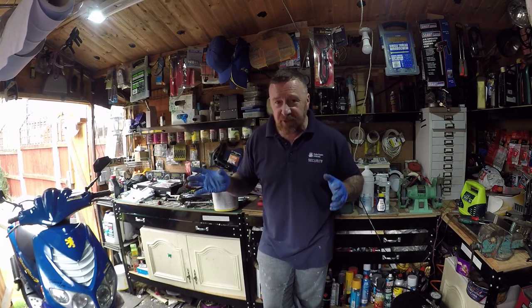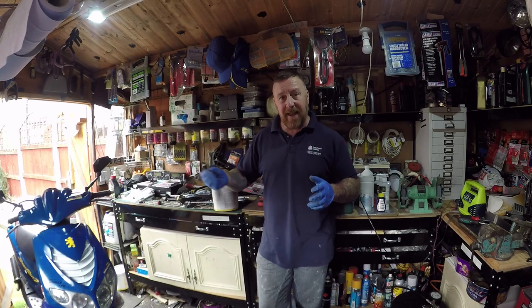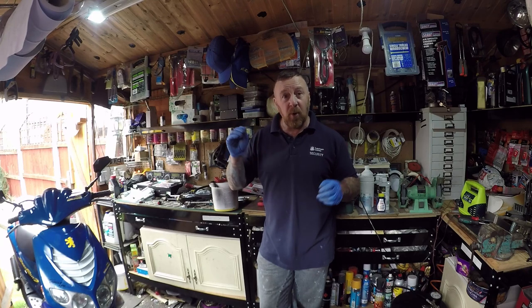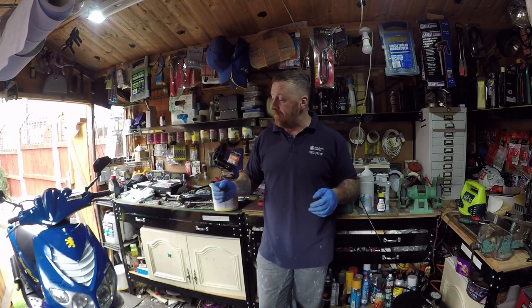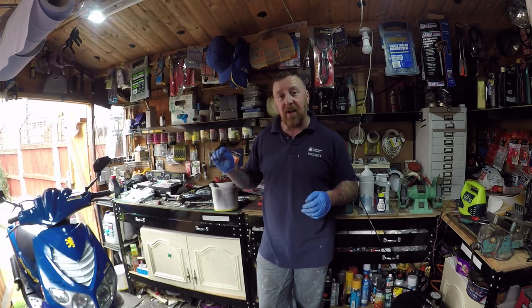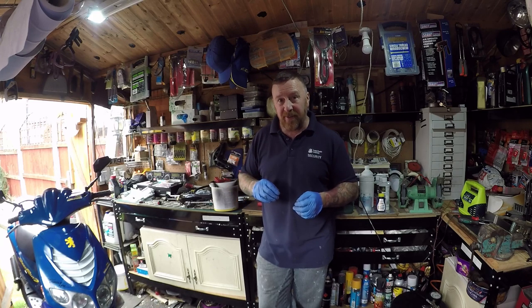So the only difference is sports exhaust and a sports air filter. So I've got more air, and more gas is coming out, but still running rich, too big a jet. Too big, too small, can cause the same problems. Once I get that carburetor sorted, then I can relook at whether the variator is running right, got the right weight in there. I may have to play with that some more.